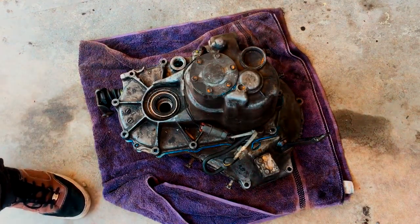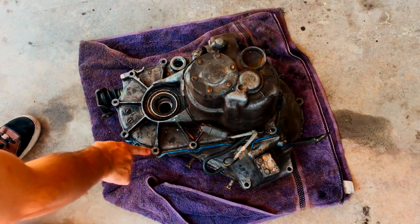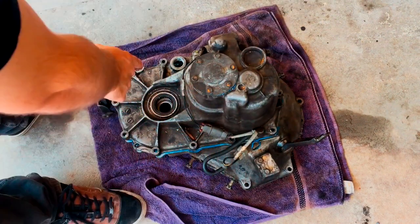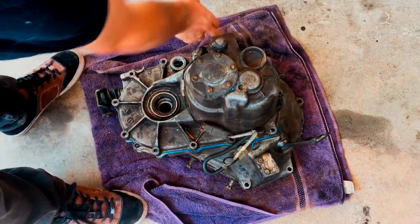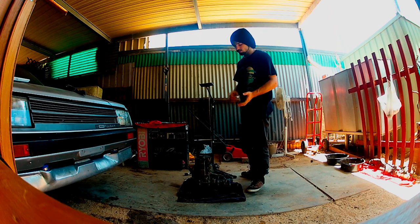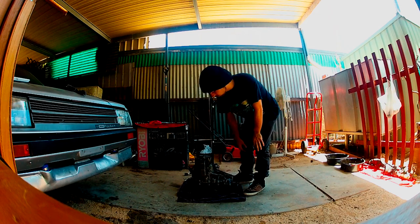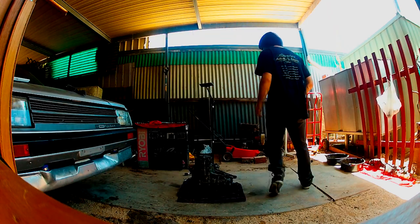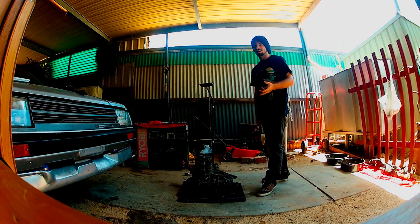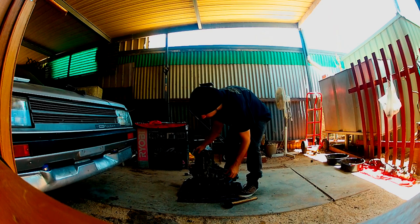To start off, you're going to want your N12 gearbox and you're going to take out all of these 12mm bolts that keep the bell housing on. Go around and crack all of those off, preferably in a cross pattern. Now in order to split the bell housing, if it hasn't been split in a long time, don't use flathead screwdrivers as it can damage the bell housing. Grab a good rubber mallet and just go around the box lightly tapping it. It may take 5 minutes - every couple of taps try and wiggle it a bit and eventually you should just be able to pull it off.